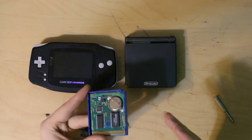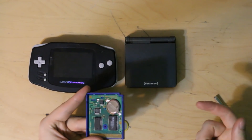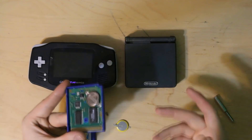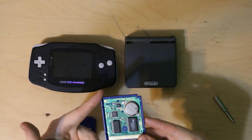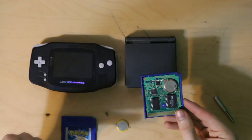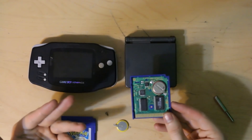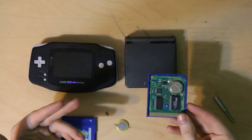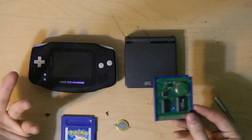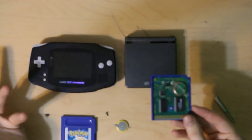Now, it will still hold a save file, but if you were to go off and play through this game, it's very, very likely — if not almost 100% — that the save data will just magically erase after a given point in time. Think of it like a remote control: you can have a remote control for your TV, and it works once or twice and then completely dies. They'll hold a charge for much longer than their lifespan, but once they're past it, it's almost inevitable they're going to erase their data. I remember when I was in 7th grade, they had a Super Nintendo at the Rec Center with Super Mario World that just always kept resetting. Now I know the battery was dead in it — the console wasn't messed up, the game wasn't messed up, it was just a dead battery.